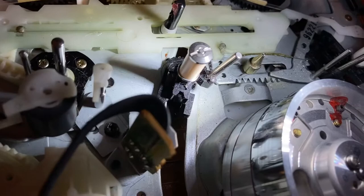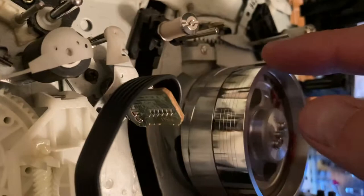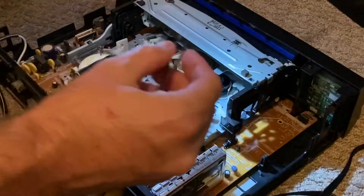Let me show you what I did that didn't work, and then what ended up fixing the problem. One important thing: I made sure the power was off — I unplugged the unit and stayed away from any bare metal parts connected to the circuit board. Some of the little metal pieces that guide the tape needed cleaning. With the cover off and a tape inserted, you can actually see the guides and how the tape wraps around and plays.